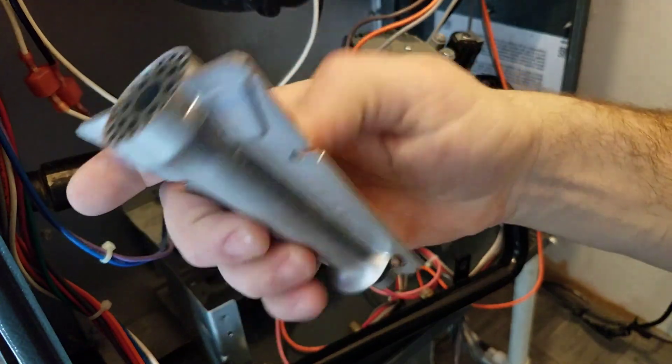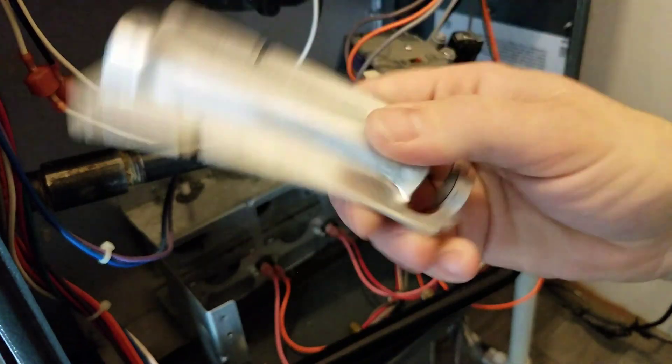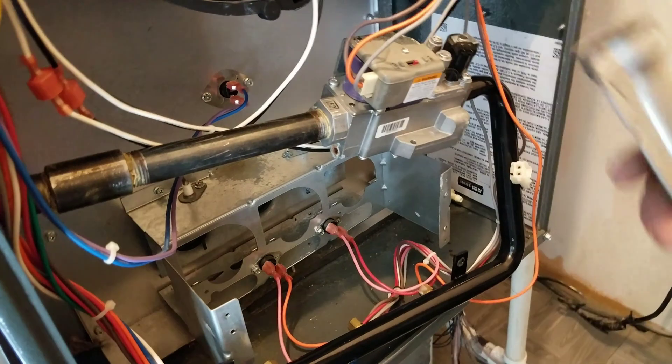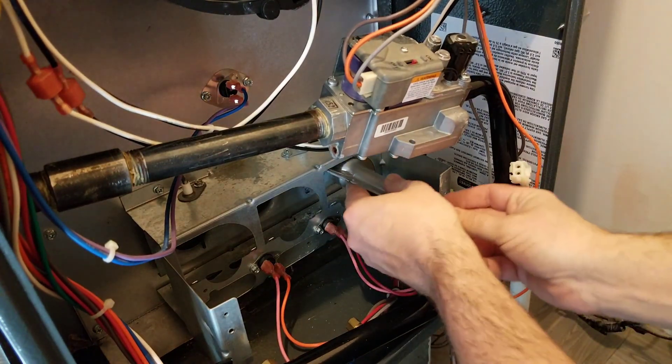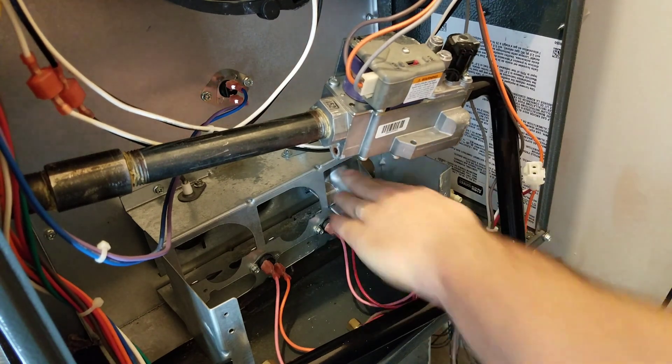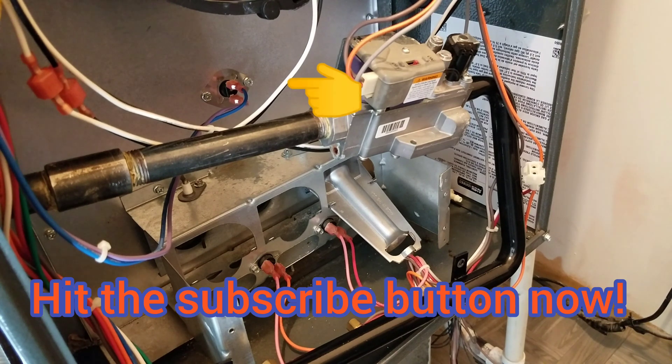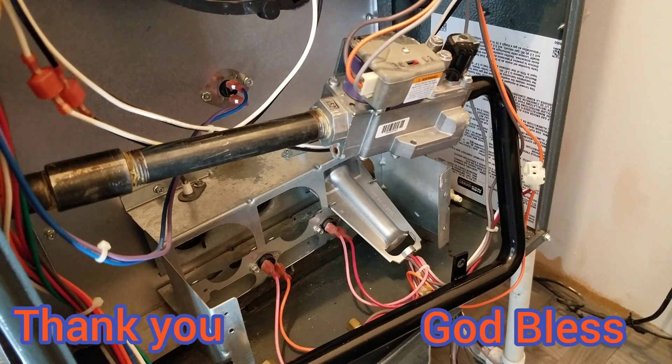As long as you didn't let it get too rusty or wait too long before cleaning, it'll be basically just like a brand new burner all over again. Burner maintenance is very important — it's often forgotten just because it can sometimes be hard to get them out. Just because it's hard doesn't mean it doesn't need to be done. Make sure you get your burners out once a year, check them out, clean them out, and your furnace will run a long time. If you have any questions or comments, leave them down below; otherwise please like, share, and subscribe to the channel. Thank you and God bless.